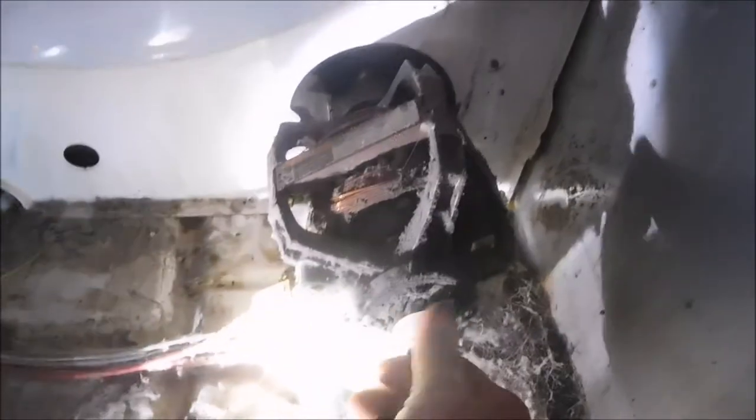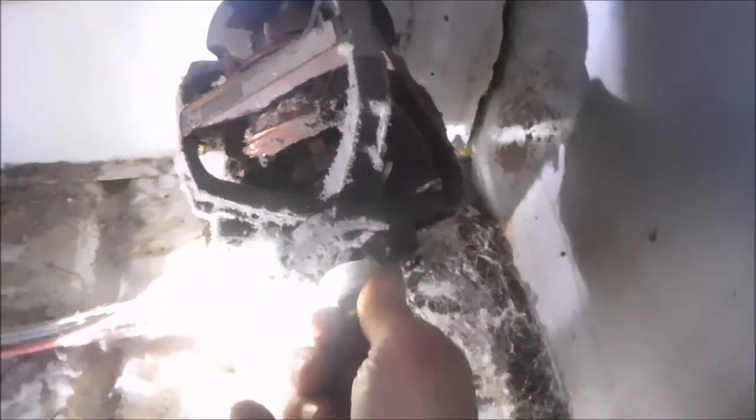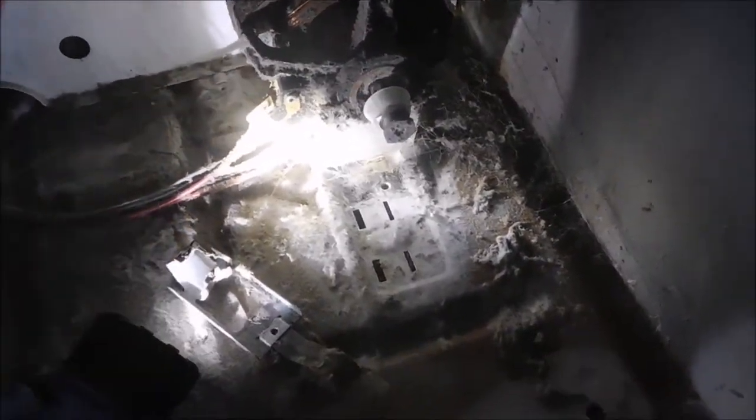This motor I was thinking was going to be tight but it's not tight, and we don't have much slop back and forth - just a little bit, not too much. So at this point I'm thinking we might have a problem with the timer, something up in the timer console. What I'm going to do - I've done this on my other videos - I'm going to basically tip the whole machine and weep the oil into the bushings.